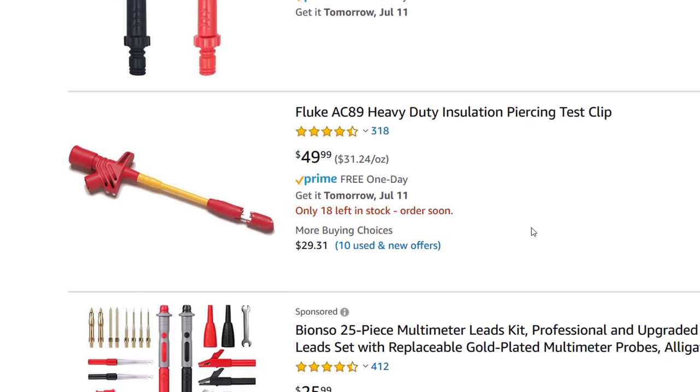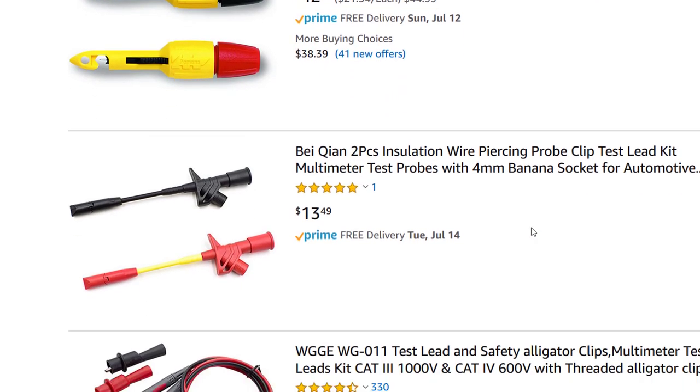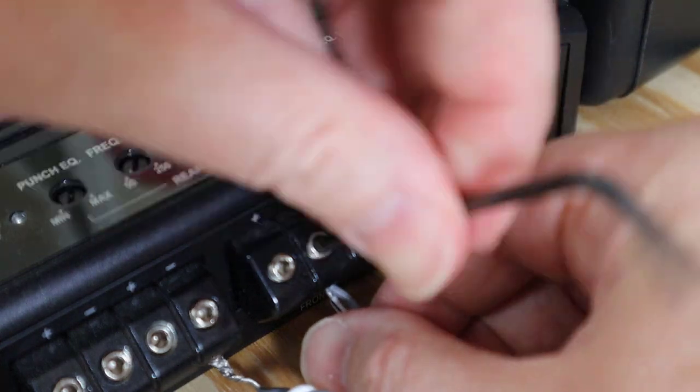Now we have to go back to the line-out converter. The input channels can be connected to just about anything at this point. Kicker's instructions say to connect these to insulation-piercing multimeter test probes, which allow you to pierce through the insulation on speaker wires to get to the conductor inside. I'm not going to do that — I'm just going to plug these into my amplifier to show you how this works. Once you've got everything set up, you can go around your car and start probing wires for signal. Make sure you've identified speaker wires first — you can probe the outputs from your factory head unit, at your speakers, or anywhere in the system.